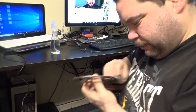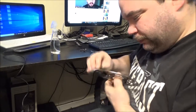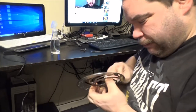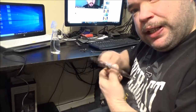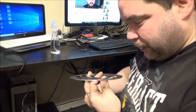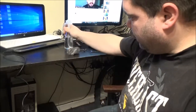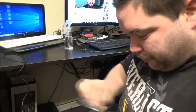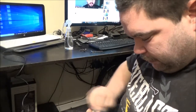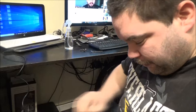You could use other cleaners — WD-40 is a good degreaser, but it'll leave a residue on here and then your brakes won't work, so I'd actually advise against using something like WD-40. The reason I'm using a clean piece of steel wool is so I don't cross-contaminate or get any other contaminants on the disc.